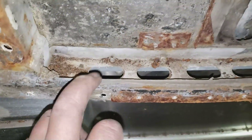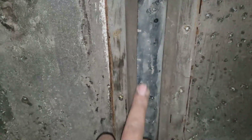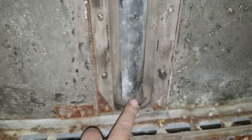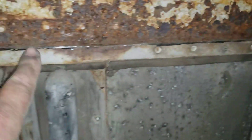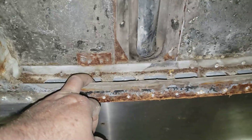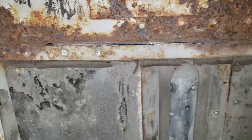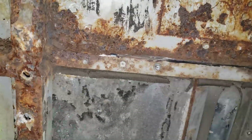This is the factory driver's heater air intake, and this is the shut-off for the inside and outside air. I'm going to keep all that and put an aftermarket heater in - Vintage Air - possibly air conditioning but a heater for sure. This panel here was the only one that was really rusted out, I'm assuming because water and moisture from rain would come shooting up and hit this panel and rust it out. So I'm going to replace that with a piece of stainless - pretty sure I can form a piece to fit there and just weld it in.